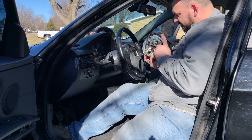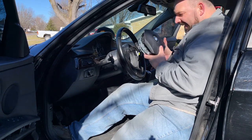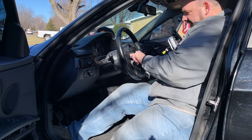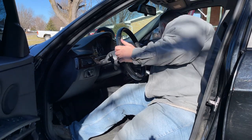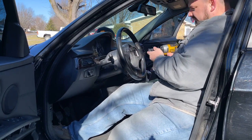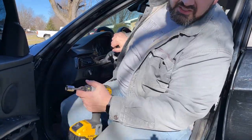It's a little tricky but it's not too bad. I've certainly spent a lot more time than that trying to get an airbag out of a car before. Airbag out. That's a 16mm bolt there in the middle - or rather a bolt, not a nut. Going to need an extension, give me just a second.